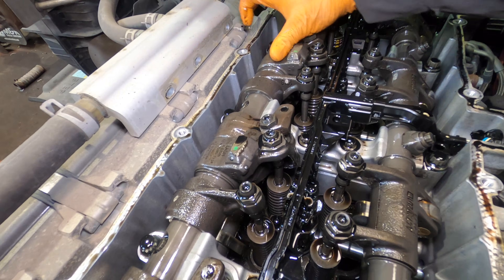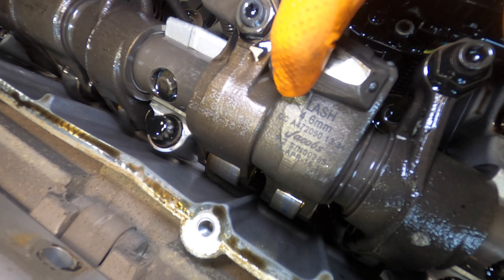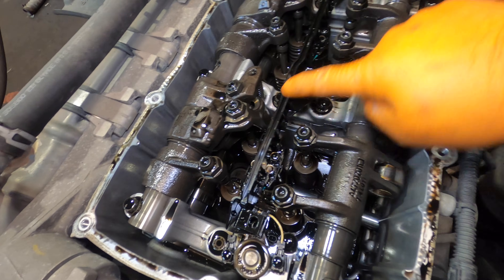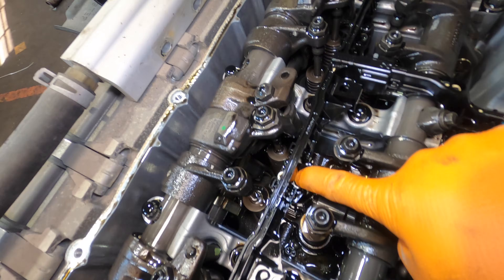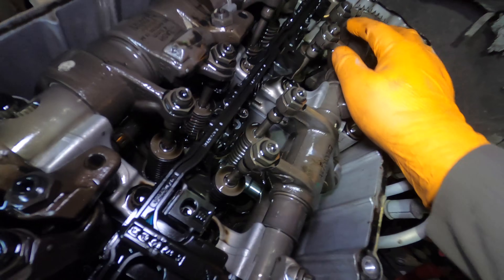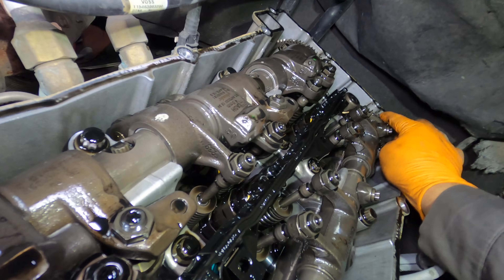On these it's nice — it tells you the adjustment right on there. You can see the lash we're going to be using: 4.6. So we're going to use the 4.6 to adjust the j-brake on these. Got your injector harness right here — injector number one, two, three, four, five, and six.